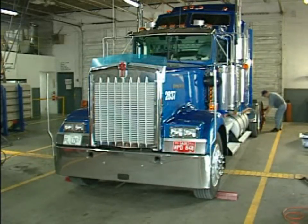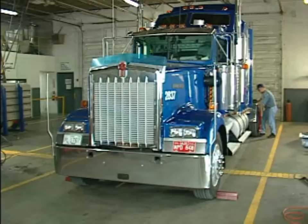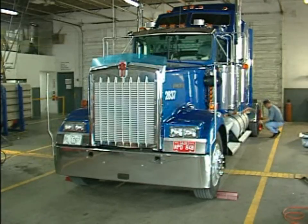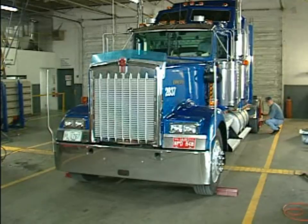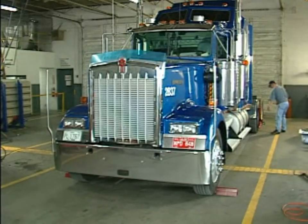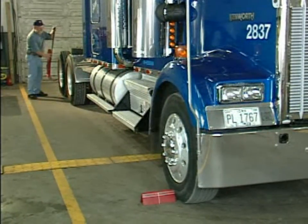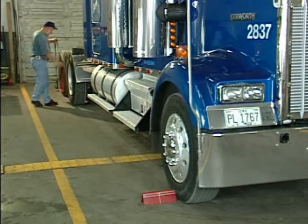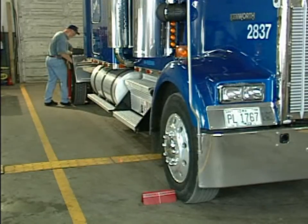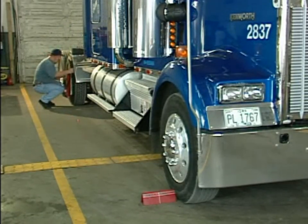When you've completed measuring one axle, you simply move the lasers forward to the next axle, if there is one, repeating the process we just did on the rear. Lasers flat against the tires, lasers shooting forward and hitting the target at the front of the truck. One side measurement is obtained, then we move to the other side of the vehicle and repeat the process. This becomes a very simple process — no great magic involved, no great complications and calculations involved.